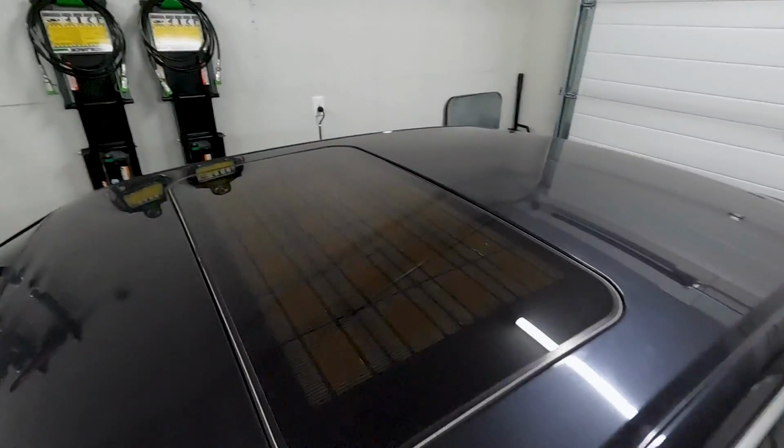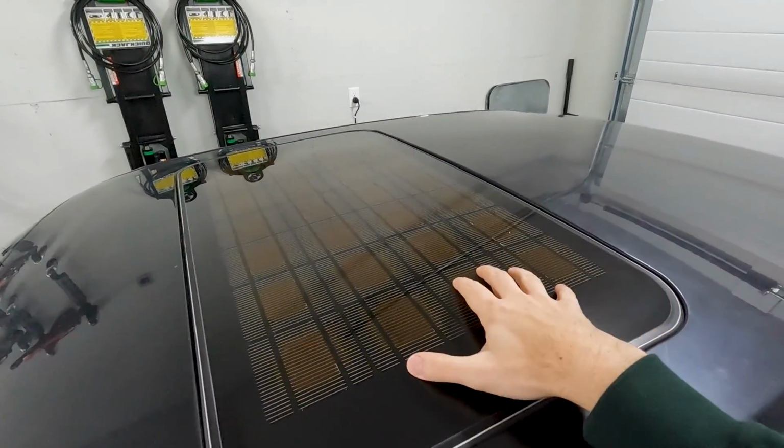Now this car is lucky to have a bit of a rare feature on it too, and that is the solar roof panel. That's what these are, and it's kind of cool because what it does is it powers, even when the car is off, the blower motor in the cabin. What it's meant to do in the summer is keep air circulating in the car and pull some of that leftover coolness that's sitting in, I think the evaporator, right? Under the dashboard for the AC system, and try to keep the car inside a little bit cooler longer until you get back. And then the opposite is true in the winter. It keeps the fan blowing to keep some of the heat circulating in the car, so if you come back, you're a little bit warmer than you would have been.